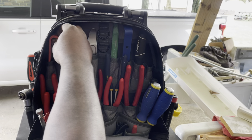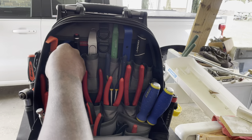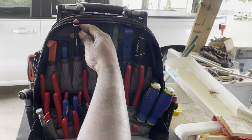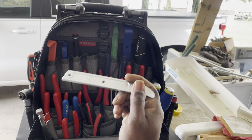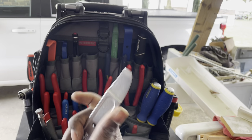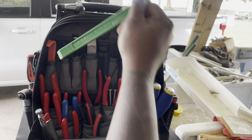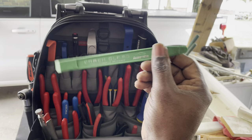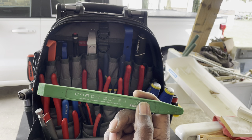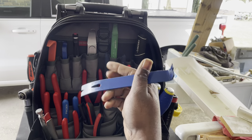On the top tier, I got my pry bars. This one's a JBL plastic pry bar, non-marring for working with radio face plates and stuff like that. This one's made out of metal so it can do heavier duty. Extra flashlight — you can never have enough flashlights. This is a Husky flashlight. A skin tool — it's a pry bar but good for sheet metal skins. Actually one of my favorite pry bars. First one I bought was Blue Point, then I started buying the off-brand ones because they're all exactly the same, and Blue Point stuff comes from Taiwan and China anyway. This is a glass tool, non-marring pry bar, which I use for popping windows open on Airstreams — they always get stuck in the summertime because the gasket gets gooey and sticks to the glass.